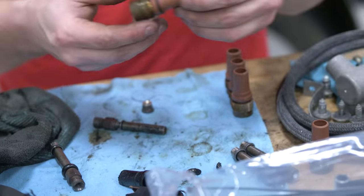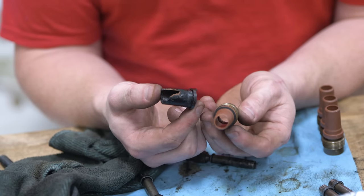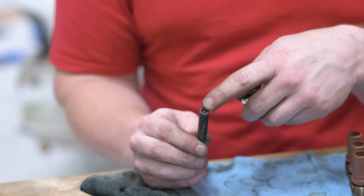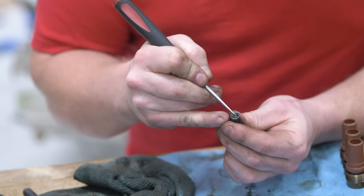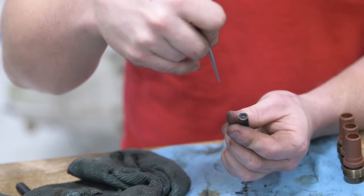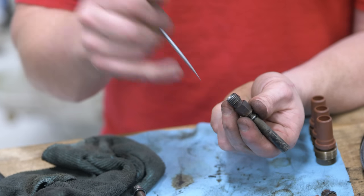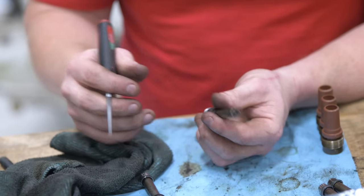and then these plastic guys that they don't make anymore are the replacement for these, which just fell apart when I took them out. So I'm cleaning not only the cap and under the cap, because there's a bunch of carbon buildup in there, and that's just gonna make your spray pattern go wherever it wants, but also been lifting up the little pintle in here and flushing brake clean backwards through the injector so it cleans out the little screen that's inside. Also, pushing brake clean through this way. So just by putting a little brake clean in here and then pressurizing with air, you're able to get it to basically actuate like the injector would be when the engine's running.